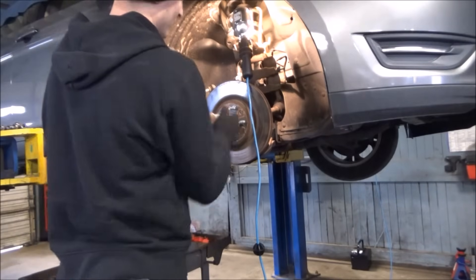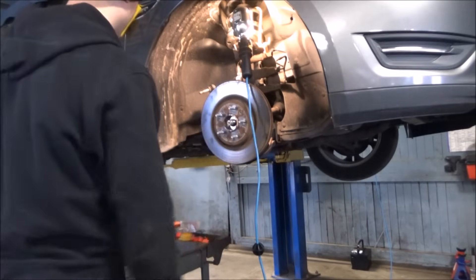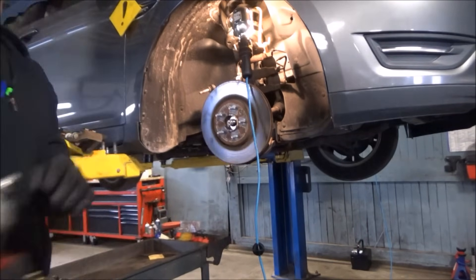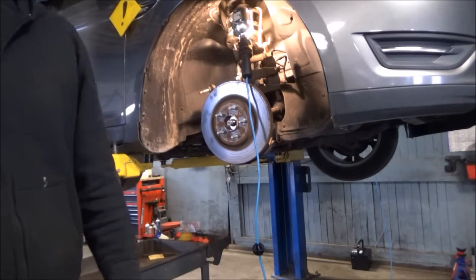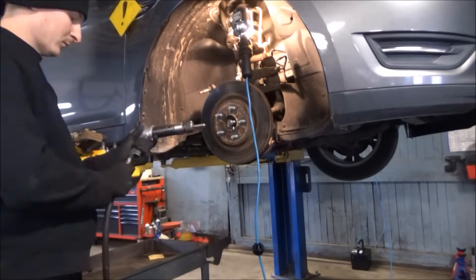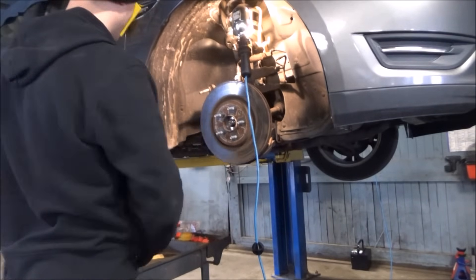You don't truly need to disconnect the axle nut, but there's a reason I'm doing it that I'll get into after we actually have the powertrain out of the vehicle. The most important thing is you want to make sure it's separated from the splines of the wheel bearing and that the outer joint can move freely in and out.